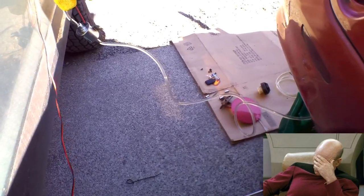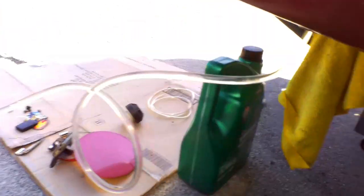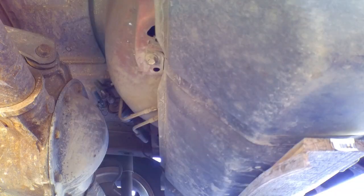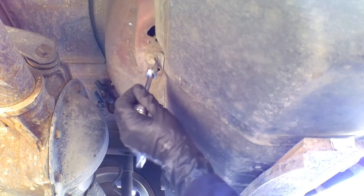So I thought I was going to end the video there, but unfortunately I have to siphon my gas because my tank was full. I'm going to have to drop my tank because the filler pipe is at such an angle I can't put it back into the fuel tank, so I have to drop the fuel tank itself to be able to get that pipe in. This is the best angle I can get for you guys to see — this is underneath the fuel tank. These are two brackets — there's one here you have to remove and one down there, and there's a bar that goes across.